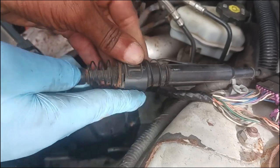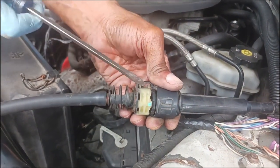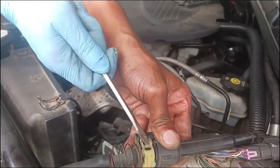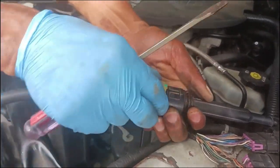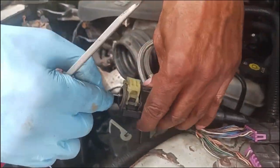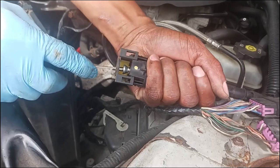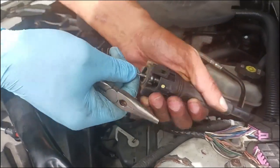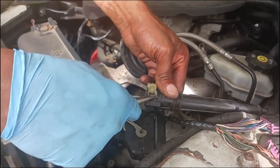You want to slide that back and the white plastic you see there has to be popped out — that is the lock clip. It's a good idea to mark this old cable right there where you see the springs are, to get a general idea of where you're going to put the new one back. The clip is adjustable, so if you don't get it back in the exact right position you can put more tension on or release the tension. If your gears don't line up perfectly, it is adjustable. So I'm going to pop that out completely.